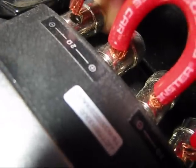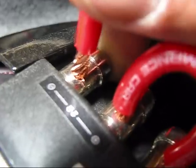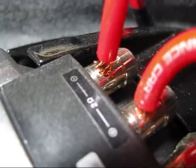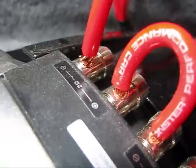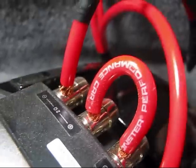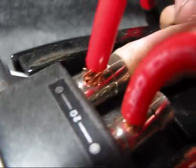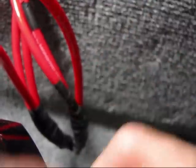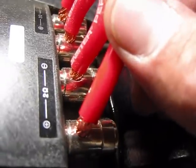When you order a subwoofer and you read the specs and it tells you the terminals are intended for 8-gauge wire — they weren't kidding. Doesn't get any tighter than that. I think the monster cable's a little bit oversized for 8 gauge, but if you strip it and you screw up the end of the wire, there's no chance you're ever getting it in there. But once it's in there, that's it — just a little bit of movement and it's tight. So I've got them hooked together. The T here — the wire goes straight back to the amplifier, one goes to this subwoofer and one goes to the other. So I'm running 4 ohms per sub, a 2-ohm load on the amplifier.